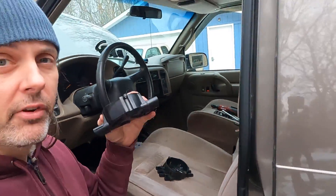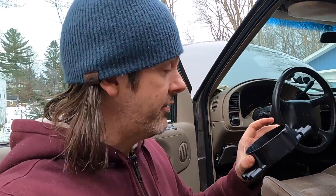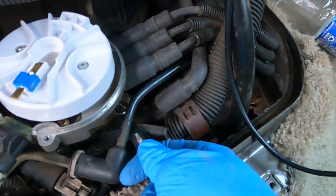In theory, what I'm going to try to do is twist the distributor a little bit, verify that the spark is happening when it should be, and then tighten it down. It'll be a shorter distance, it'll deliver higher voltage to the spark plugs, and hopefully even with a little corrosion, because that distance is so much shorter, it'll just be more reliable for a longer period of time.